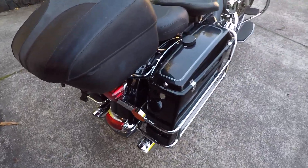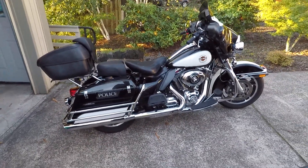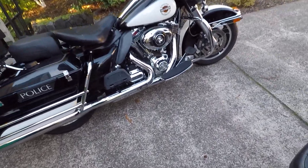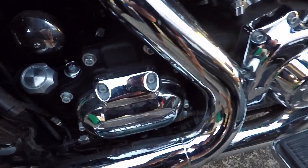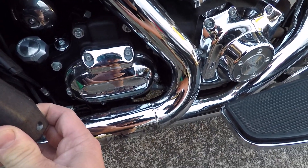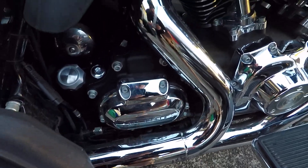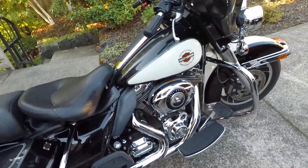It works, it's got the keys to it, it locks. Once I get a regular tour pack, that'll be up for sale as well. I just wanted to give you a short video of this bike. Took it for a little ride — the tires were low, it's been sitting for about nine months. Got a little oil leak. These transmission bolts back out; I guess that's a big problem. It was leaking oil all over the exhaust and stinking a lot. Thank you to Paradise Harley — a couple of the techs gave me some pointers and lent me a wrench. This bolt right here was the only one that wasn't finger loose on the tranny cassette, so I tightened all those down and the leak seems to have subsided. I do have a new gasket I'll probably put on when I get time.